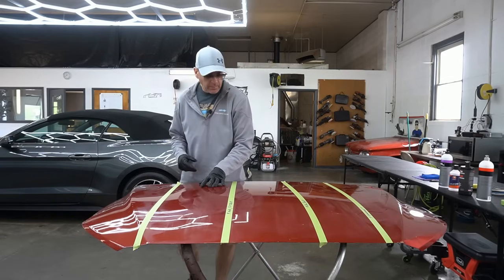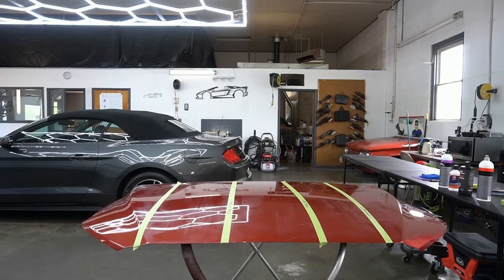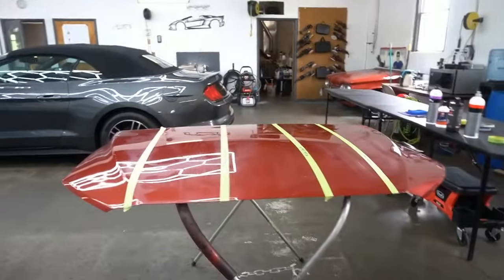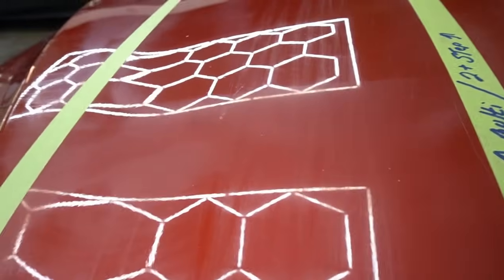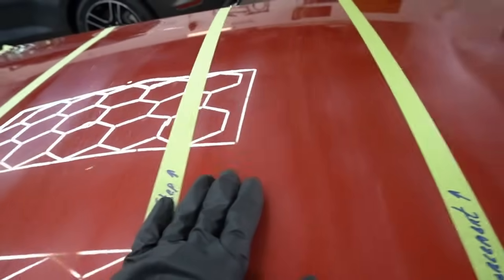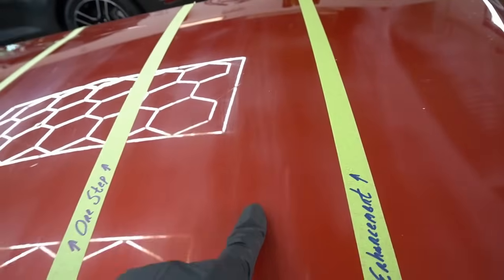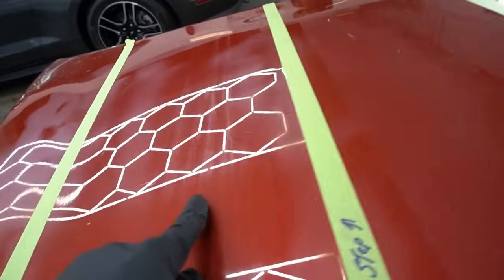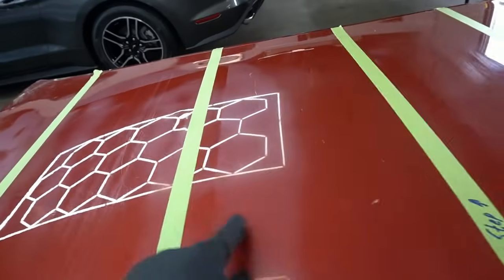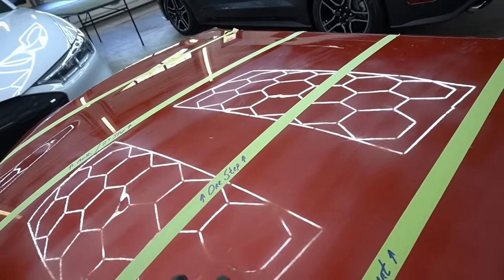So what I have here is a test panel, and let me grab you and get you off of the stand and bring you closer. Three layers of imperfections. We have a lighter layer with 3000 grit that hazed over the section. We also have a layer that is 600 grit, which is deeper in each section. And next to that is one right in between at about 1500 grit. So there are layers of damage to the test hood here.